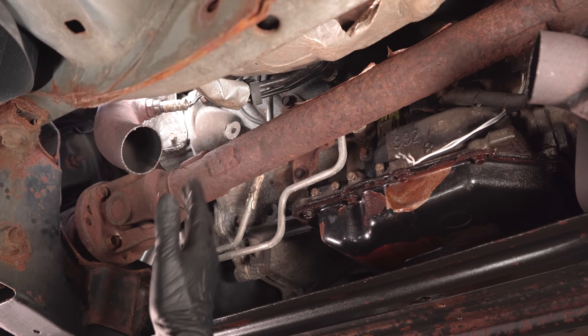This is one of the reasons I want to do this whole thing as an assembly. If I just weld in a piece of pipe with a catalytic converter in it, it's going to be extra work here. Instead, I'm going to combine the two problems and replace the catalytic converter pipe, which includes this right here — and that basically forces me to fix the exhaust leak because this has to come apart. Now I have a brand new pipe with brand new catalytic converters and no exhaust leak, all done as one unit. My second reason for replacing both: only one got stolen, but this one still here has almost 150,000 miles on it.